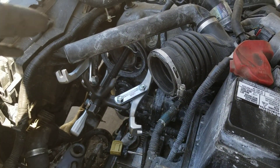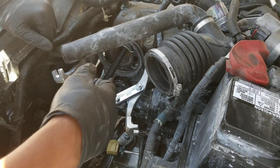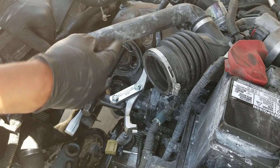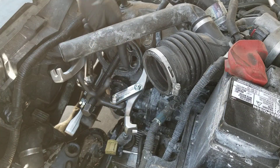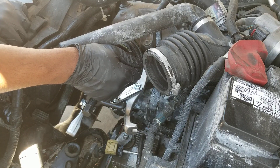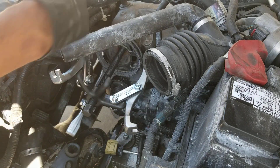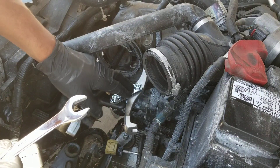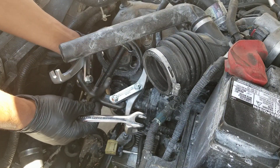You also have to take off the belt. I have a pry bar. This camshaft spins counterclockwise, so put the pry bar on this side and pry the belt off. We got the puller on — it's nice and tight, grabbing behind as you can see.